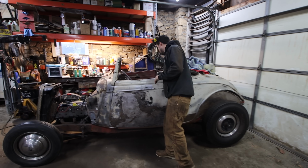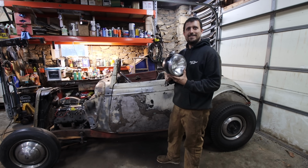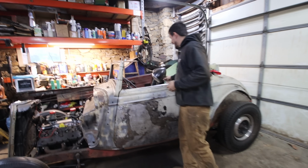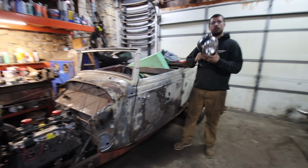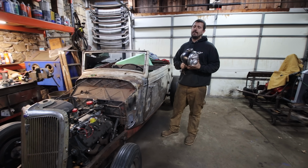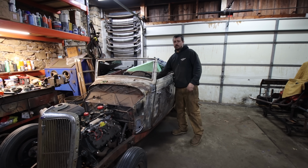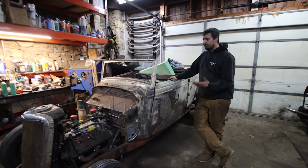Then I have the tried and true Guide 682 Cs for the front with these stainless brackets to mount to the frame. So those brackets fit, or do we need to heat and bend them? They fit. I had them clamped on in the car pretty well. At Wheels of Time, did you have them on? I had them on before. I didn't take them there because I have to put riv nuts in the frame, so I just clamped them on. They look good. It's just I need to drill holes in the frame, put riv nuts, bolt them on. And then wiring, that kind of stuff.